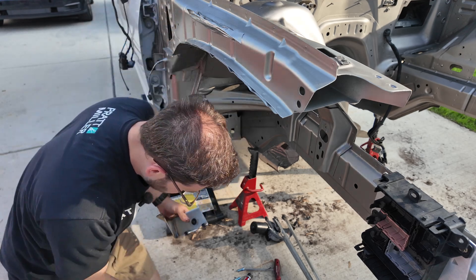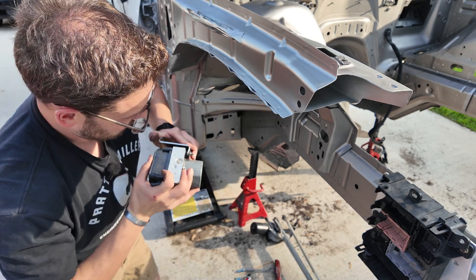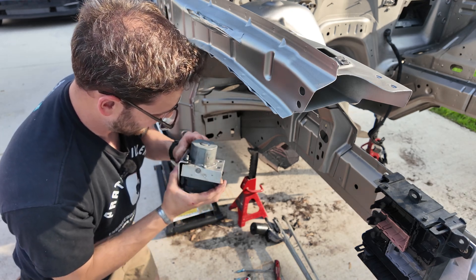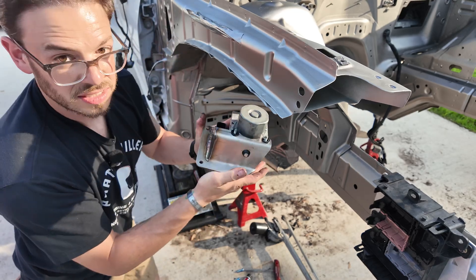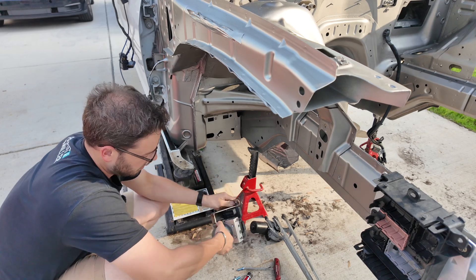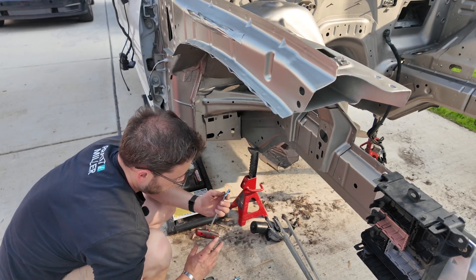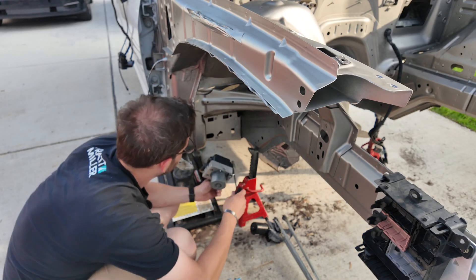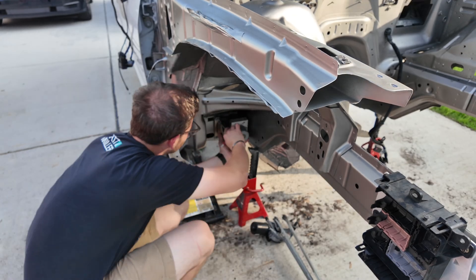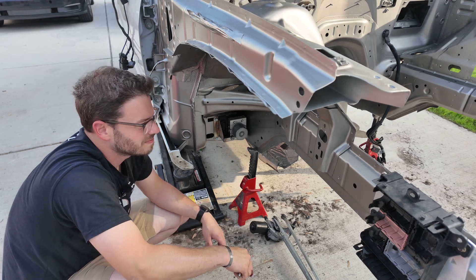Alright, so three grommets in the hole. Slide the ABS module through the front ones - oh, it pulled the front ones out. There we go, push those down in. Alright, now I'm in the bottom one - front ones. Module's held in place on the bracket, that ain't going nowhere. Throw some Loctite on the first bolt and put it into the rivnut. And there you have it - a relocated ABS module. Pretty slick.